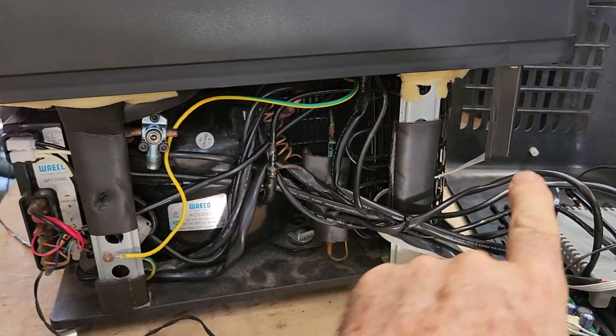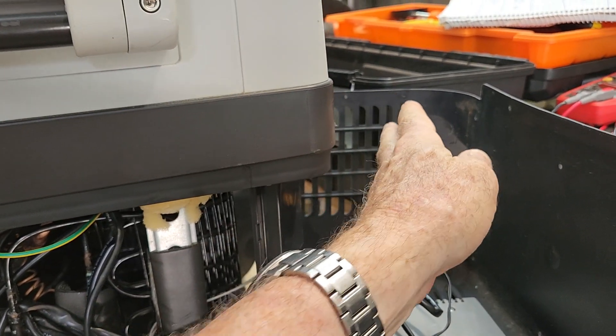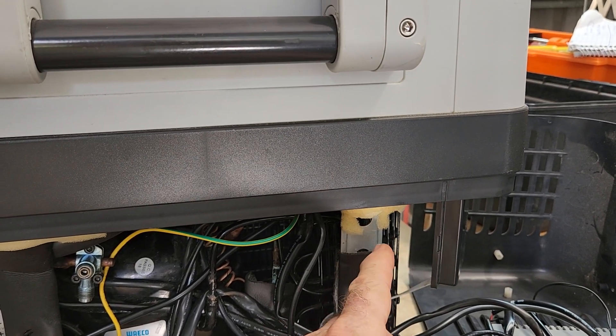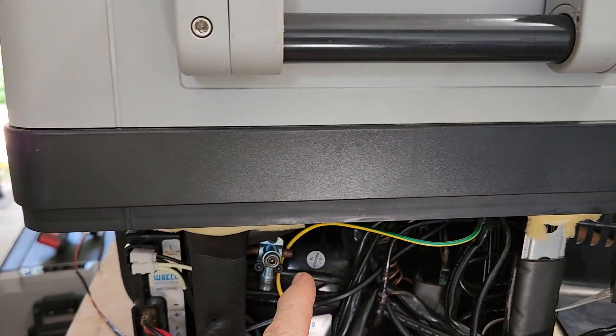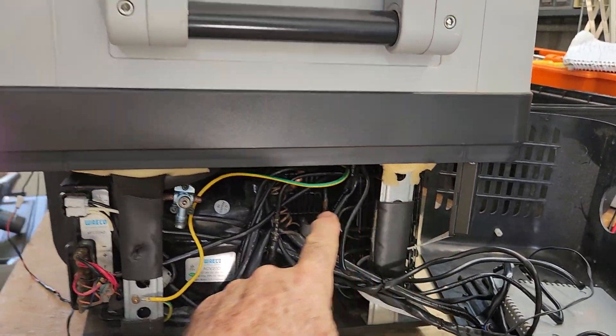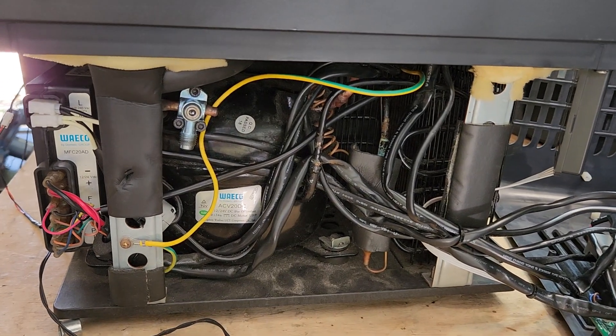This is particularly important in hot weather - absolutely critical. You can't afford to have your fan fail. Looking at the design of this fridge: the fan sucks in ambient air from the outside through a grill, pushes it through the condenser unit which cools the refrigerant, and as it's wrapped around, air flows across both sides, then across the compressor and even cooling the compressor controller, exiting on the other side. It's a tunnel arrangement - a tunnel of air passing through all these elements.